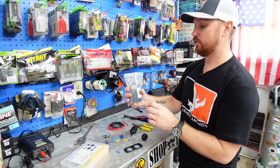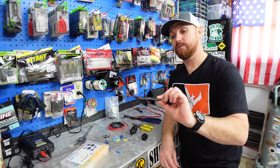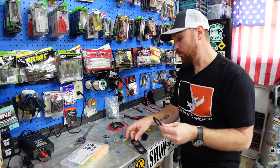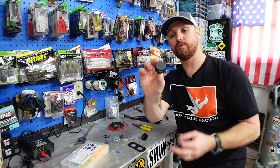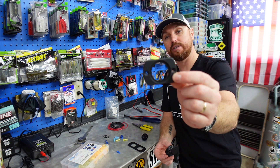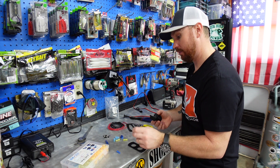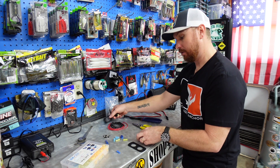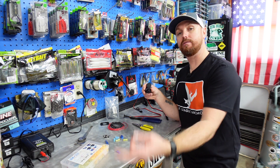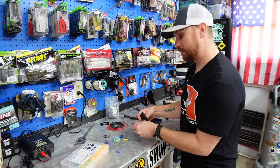This is the variety bag of little dash panels I ordered off Amazon. This is my last two-hole panel and that's what we're going to put in today. If I only wanted to put in the dual USB port, I could just go with a one-hole panel — drill a single hole, use this plate, it's nice and clean. I want a two-hole because I found this voltage meter in my drawer and I really wanted to keep an eye on my battery.